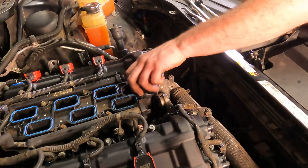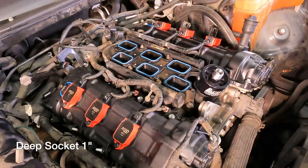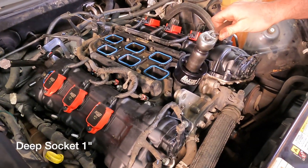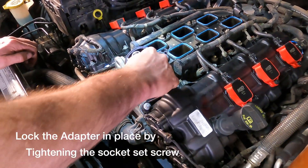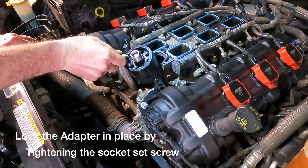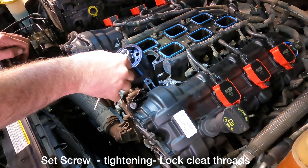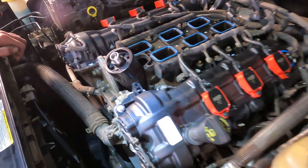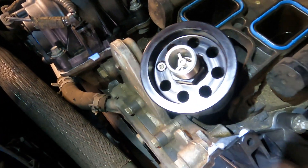As it goes in, just make sure the o-ring is not pinched, and you're going to need to use the one-inch deep socket. You can go nice and tight — don't destroy the threads, but the so-called plastic is actually glass-reinforced nylon, so you can cinch it down pretty good. They can move when you apply or remove the oil filter, so make sure if you can turn the adapter with your hand, it's not tight enough.